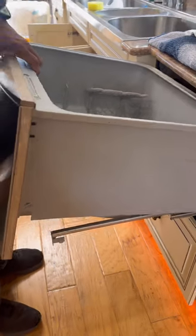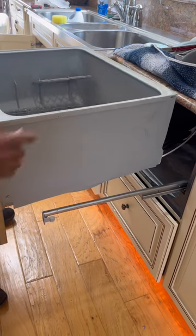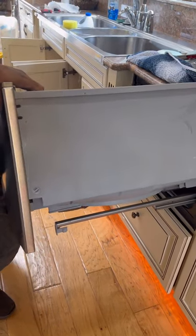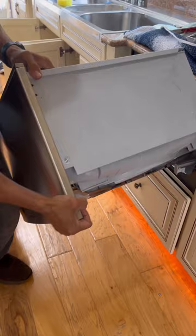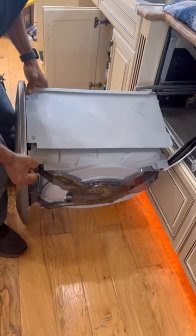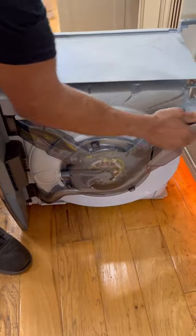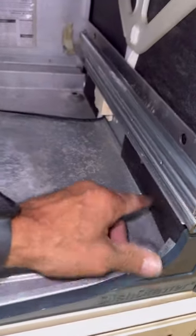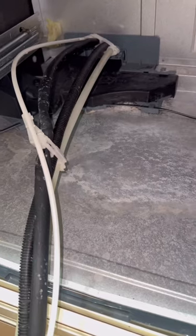So, and then once you lift, now the best way to turn these is the lines. You want to make sure the lines have adequate room. You can slide these guys in so you have access. Careful, don't damage anything. Set it down. You might have to put a box or something if yours is too tall. Now take a look on the inside. You're gonna have one screw here and one back there, another there and another there. And that's how you're gonna be removing it.